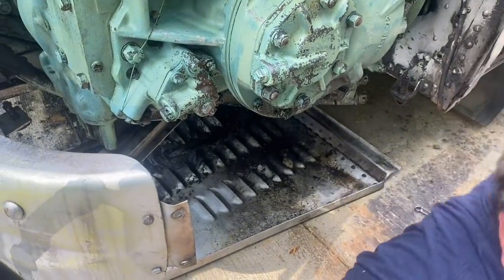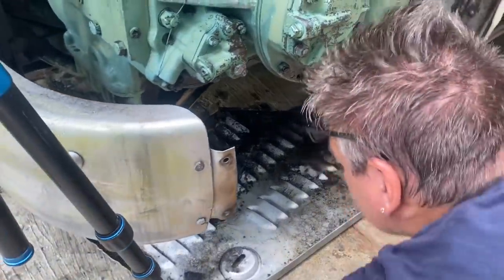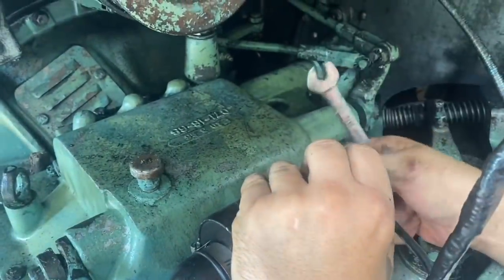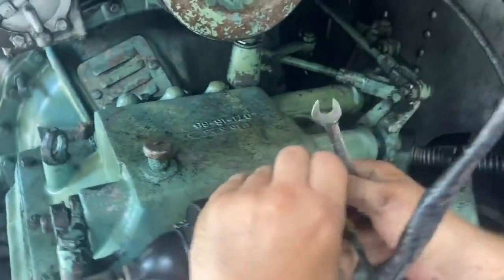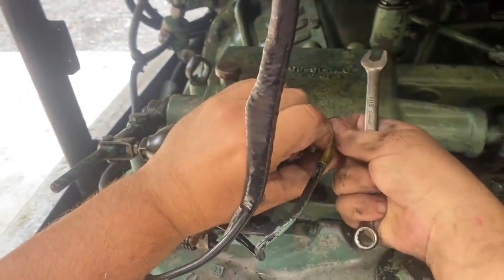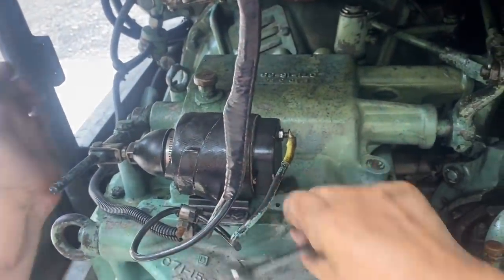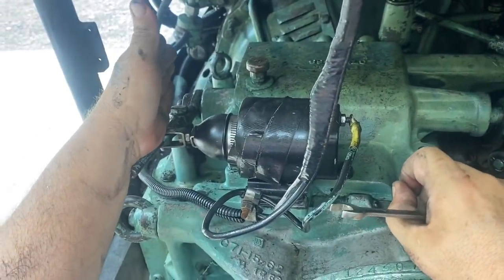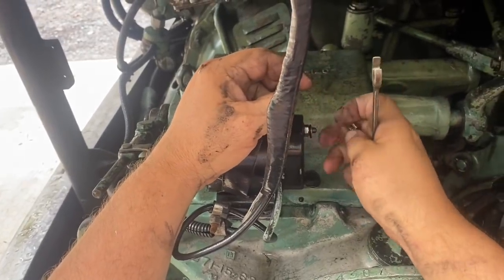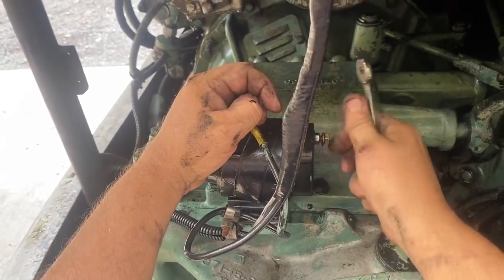That's not something you'll see every day. Very, very few buses still have this on them. This is the reverse solenoid. When you have it in first gear and you flick the little button up there, the solenoid pulls this back. Then you can go into second gear, and second gear drops it into reverse while the solenoid is retracted. This thing is like $500 for this solenoid right here. It's crazy.